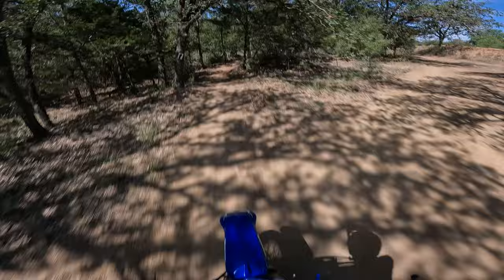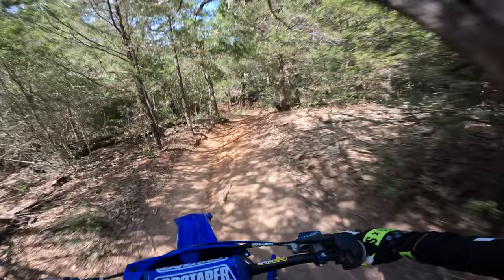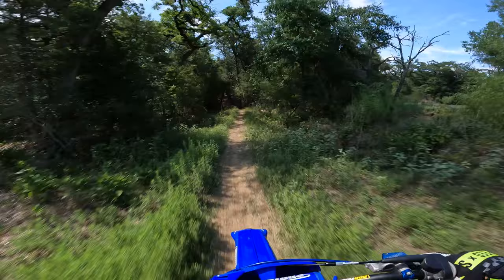I can already feel the pilot circuit's running a lot better. A lot more responsive to the gas. Climbs the RPMs a little easier. Still have a little bit of that low-end gargling, but with how responsive it's being at the gas right now, we're really not gonna change any of that. Unless we go really, really lean.